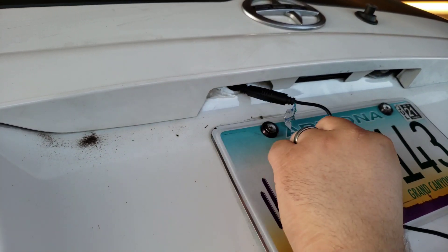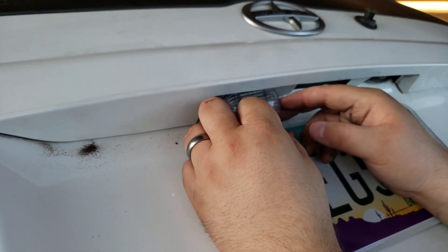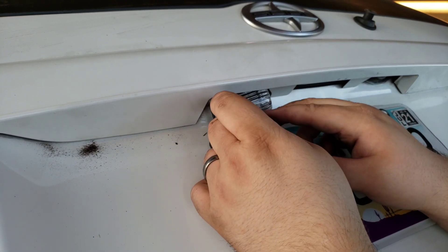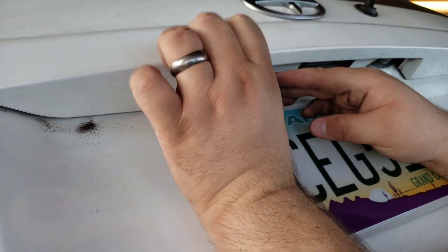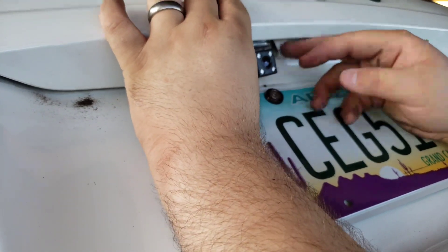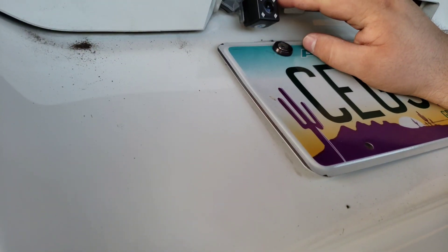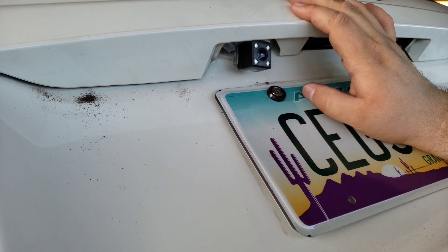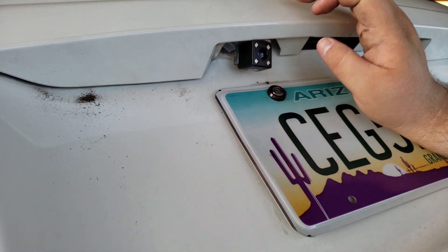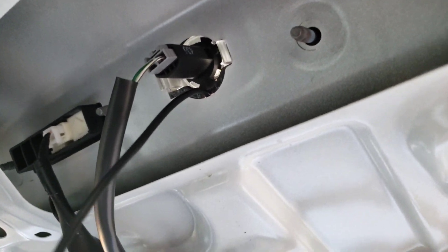Go ahead and fish these through. You can't just plug it in straight — you're going to have to fidget with it, get it twisted in there. You'll get this side in and then clip the other side over. After fidgeting with it, I was able to get the rear bulb installed. Now I have an LED bulb so it didn't really like it, so if you have the factory bulb you'll probably be just fine.